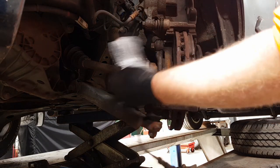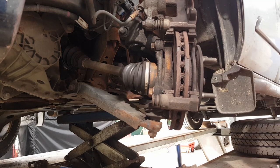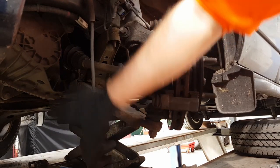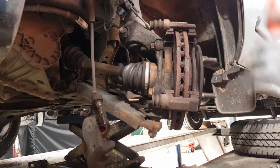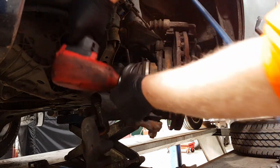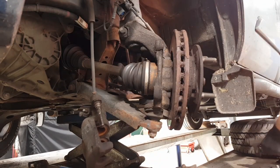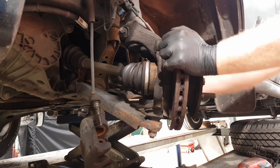Remove the brake pads. Then remove the caliper - you don't need to remove the top bolt, just slide the slider straight out and let it dangle. You can cable tie it up, but it's a straight hose so it won't be hurt. Now undo the two carrier bolts, which are also 21mm, and remove the carrier. That's the easy bit done.